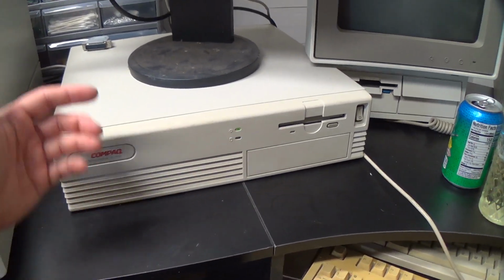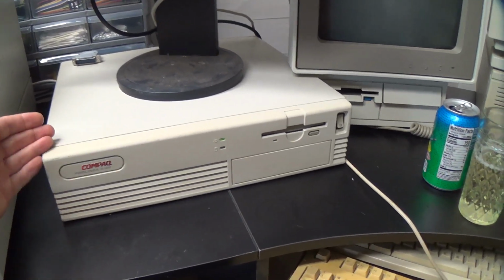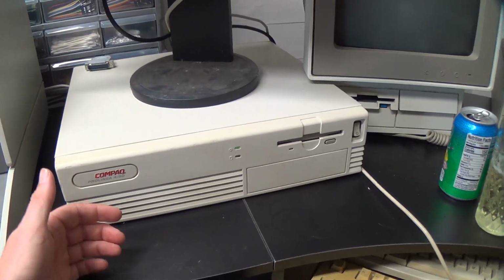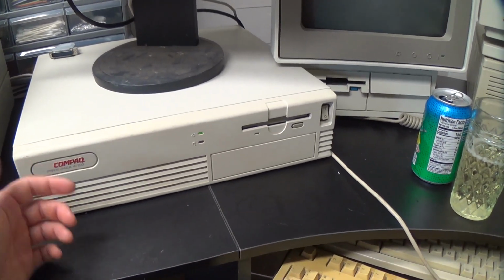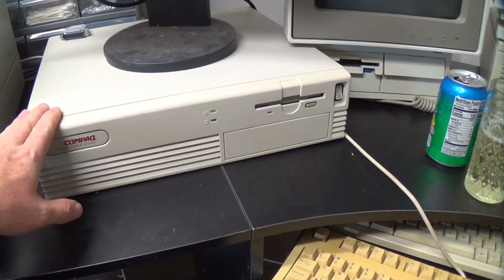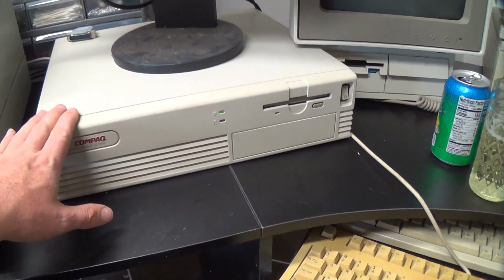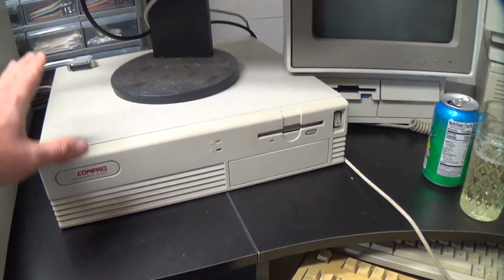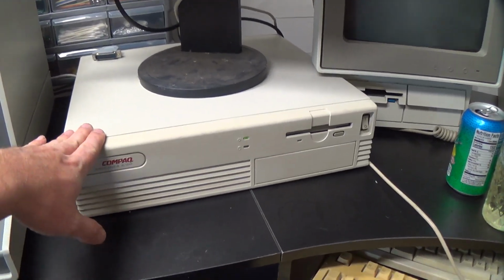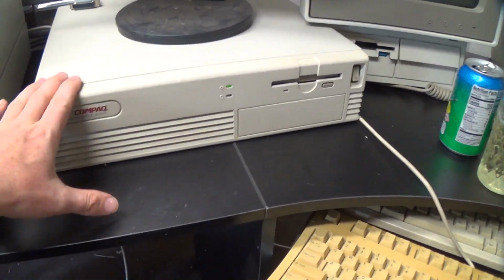I don't know, it may be a 3.3 volt module, maybe it'll still work in this thing, maybe all the COAST modules are 3.3 volts, I don't know. I guess if it blows up, we'll see, but I don't know when it'll get here. But if we add that L2 cache to this thing, that should speed things up a good bit. And also, I ordered a 486 DX4-100 CPU to put into this thing. I think that's the safest thing to try.